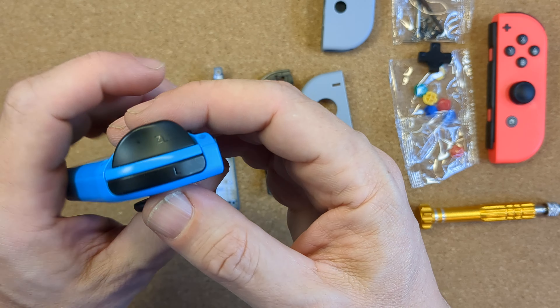After that it all gets a lot easier. Locate the mid frame and put the three gold screws in place to secure it, being careful to make sure the little antenna board and wire are out of the way before those screws go in. Now the battery — put the cable clip in place first and use the spudger to snap it down. The battery sits flat and sticks down. The little antenna board and its wire need to go around the small channel around the battery before they slot in place, and the spudger is really useful to help nudge the wire in place. Almost done — just relocate the rear shell as before, start on the rail side making sure the tabs are located, then flip it over, pop the clips together on the other side and put your four tri-wing screws in to finish.